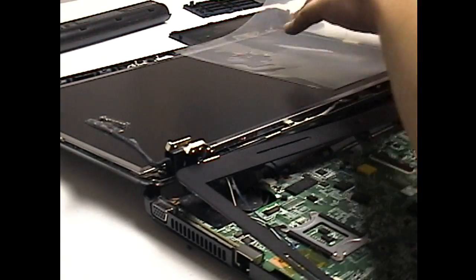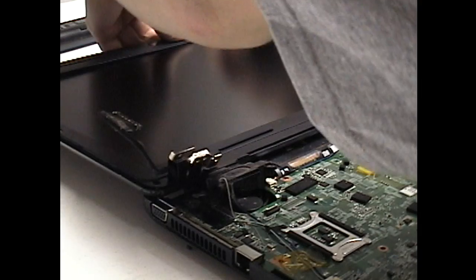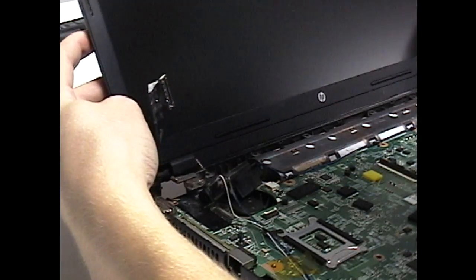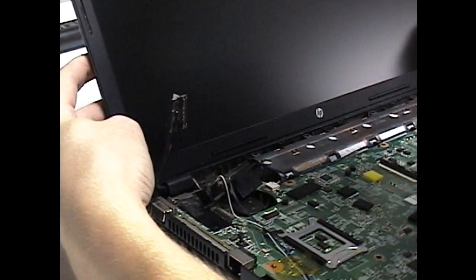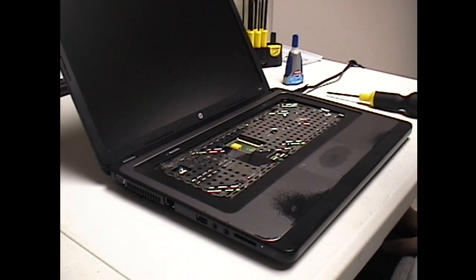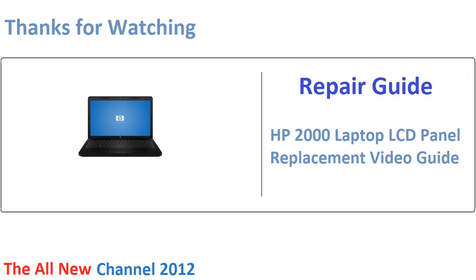Now I'm going to remove that protective cover. Interestingly, my replacement screen was a matte finish instead of a glossy one, which I actually prefer — I think it looks better. Next, snap the frame back in. Now would also be a great time to put those little corner screws and stickers back in. Line the hinges back up with the case and screw them in the same way. Then perform the reassembly process up until you've got the power button plugged in, and just make sure your display works. It appears we have a working system. From there, the reassembly process is just the reverse of the disassembly process.